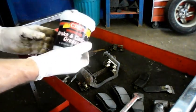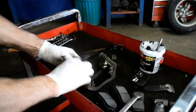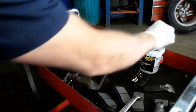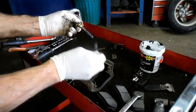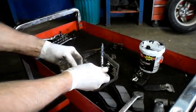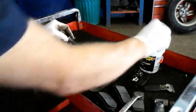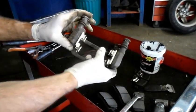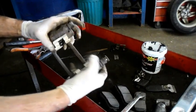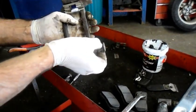Next thing we're going to do — as you always see me do — is put synthetic grease on these. Anywhere that the brake pad touches, you put the grease on. You're also going to lubricate these slide pins here — you have to make sure that these pins slide nice and freely. If they don't slide freely and stay binding, it's going to prematurely burn up your brakes. Pull the pin out, lubricate it like this. Do one pin at a time because they have to go back in the same hole they came out of. See how this one is different — it doesn't have the O-ring on it — so just lubricate it like this and push it all the way back in. When you push it in, make sure it snaps all the way back in to where it's supposed to be — see, it pops up. So now no moisture can get inside here.